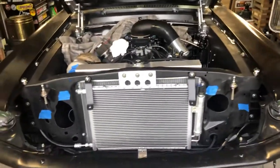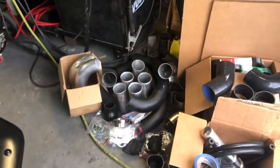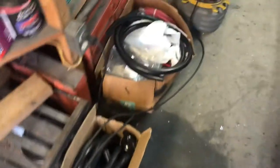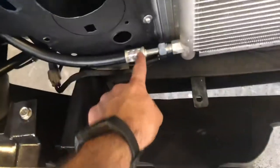I got the condenser mounted and I've got a bunch of AC stuff. I got some cheapo AC fittings — about four or five foot of number ten, number eight — but those dryers don't use those. The only hose I could use was the number six, which is looped up under the fender. I borrowed this crimp tool from my buddy Jimmy, and it's working great so far — I've only crimped this one line but it works wonderfully.